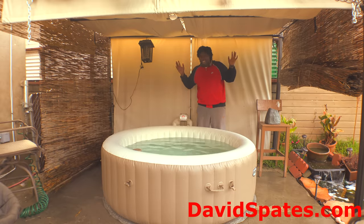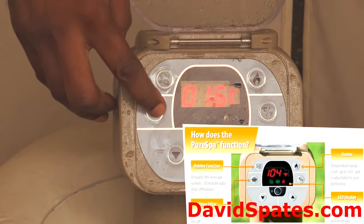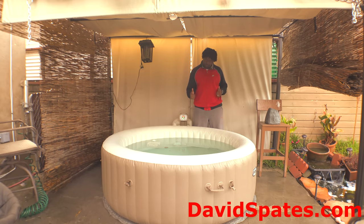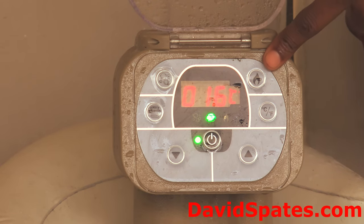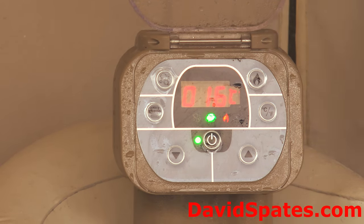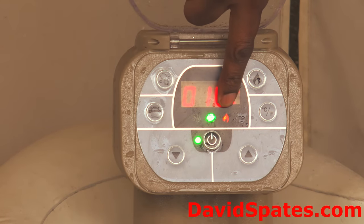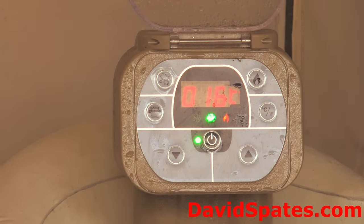Now all you gotta do is turn it on and get it hot. First thing you do, hit the little power button. Hear the beep. Green light on. You know there's power to the base. Start your filter system. Boom, there you go. Now the filter's on. Water's going in and out, getting nice and clean for you. Because you got your filters going, you got your chlorine. Good to go. But Dave, is it getting hot? No, it's not. It won't get hot until you hit the little flame fire button. That means hot, because fire is hot. Hit that, see the little flame light up? You know you're good. Green light on the filter symbol, you know your filter's on. Little flame lit up. Heat is on. In case you forgot to turn your filter on, if you turn on your heat, it automatically turns on the filter, so you're good to go.